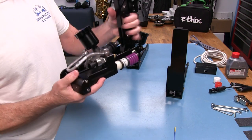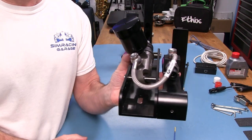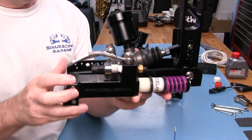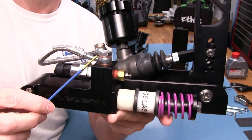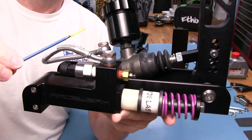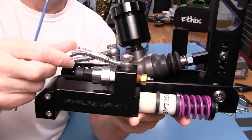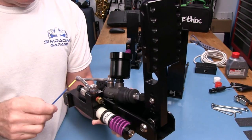Typically on master/slave cylinder setups we have the banjo bolt here along with copper crush washers. When you tighten these down, they crush and create a nice seal with the soft copper. It's just professionally done. What's interesting is that RaceWorks uses their own custom slave cylinder with their logo on it, rather than buying off-the-shelf Wilwood or Tilton units.